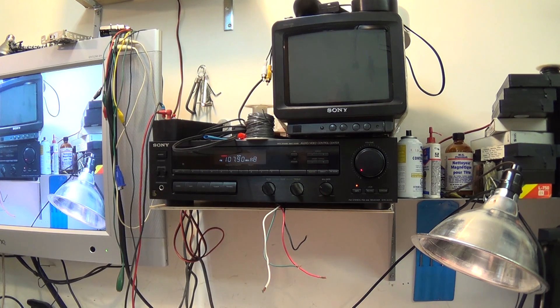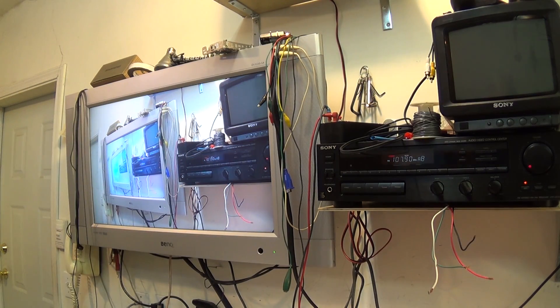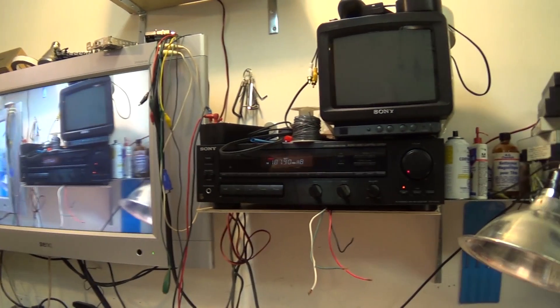The analog monitor makes tape path alignment and spotting bad heads easier because of how the display refreshes. A lot of times if you have a distorted video signal from a bad head or a tape path alignment problem, it won't show up on an LCD or plasma screen. That's because LCD and plasma screens store the entire frame of video — both fields — and display it at once, so if one field is missing or distorted, you could get no picture at all.